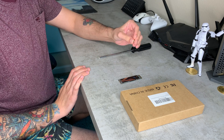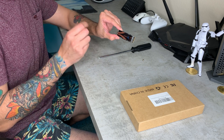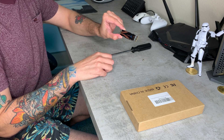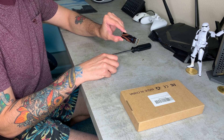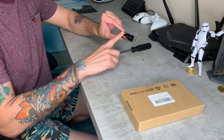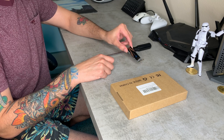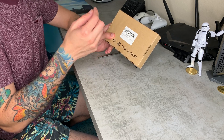We're going to need a small motherboard Phillips head screw, and then of course you're going to need your NVMe SSD. This is the Sabrent Rocket — I chose this for a reason. To my knowledge this is the fastest NVMe SSD on the market, faster than the Samsung Evos. This gets 5,000 megabytes a second down and 4,400 up. It's so fast they recommend getting a heat sink on it, which luckily this kit does include, because when it's reading or writing that fast for a sustained period it actually gets quite warm. And of course you're going to need an M.2 NVMe to PCIe 3.0 adapter.